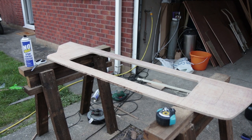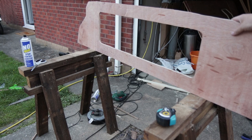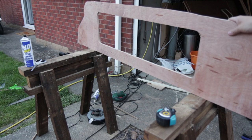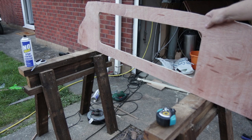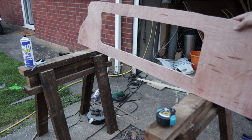The next part is to take the bulkhead — as you can see we've now cut a hole in the side of it. We took various measurements from around the outside just to make sure that the opening won't be snagging on any parts of the shelf or the original bulkhead from the van. We used a jigsaw to cut a hole out in the middle, which gives us a nice opening to pass items through into the storage unit. Down here there's a little lip so nothing can fall forward. We're unsure whether we're putting a door on this yet — once items are in there we can add a door later.